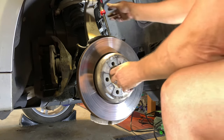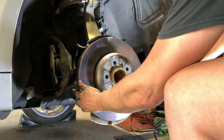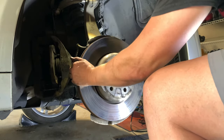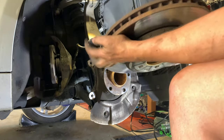The rotor needed a little convincing to come out. I tried tapping it first with a pry bar but that didn't do anything, so I just got a mallet and knocked it out. Watch your feet so it doesn't slide on your toes and break them.